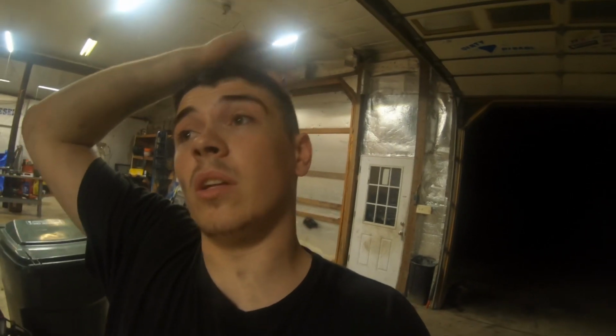Guys, that is going to wrap up the end of the video for tonight. This has been up to like 3 days now in this video, but tonight we did get both transmissions put back in the trucks. Mason's truck is coming up on boost a lot better, and he's able to launch a lot harder. And my truck currently doesn't idle anymore because the converter stall is so aggressive, but that's no big deal. I just have to turn the idle up a little bit. I did take it for a drive, and it's a lot different. I'm sure for towing and stuff it would be nice, but I don't really tow with the truck, so I probably will get another high stall converter for it, just because I liked it a lot more.